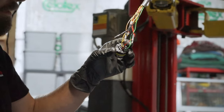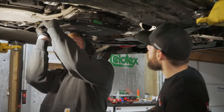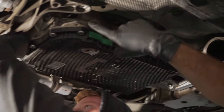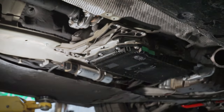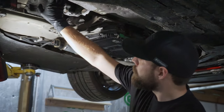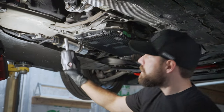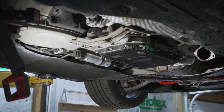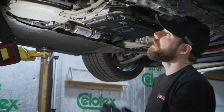The wiring harness is back on and locked in position. We're now putting on the transmission bracket, which bolts right up with the eight-speed. We already bolted up the driveshaft, so we're pretty much done underneath — besides the transmission oil lines. We have a half-inch line coming in the mail today, so hopefully we can knock that out.